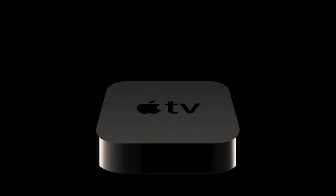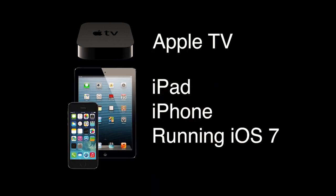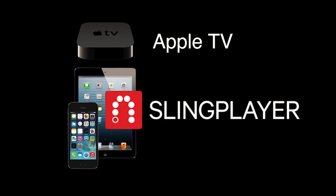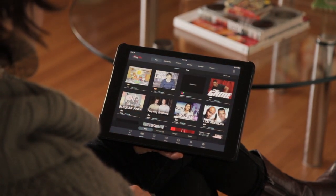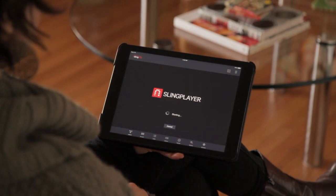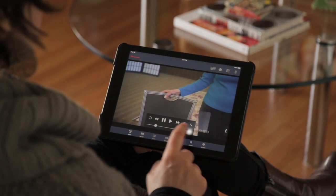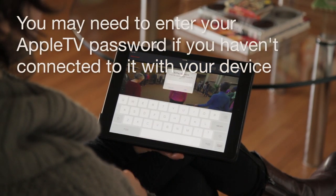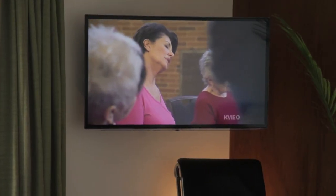In a very similar way, you can watch programs on a remote TV using AirPlay for Apple TV with an iPhone or an iPad running iOS 7 or later. Make sure that the iPhone or iPad has the latest version of Slingplayer and is on the same Wi-Fi network as the Apple TV. Launch Slingplayer on your iPhone or iPad and begin a streaming session like you would normally from your Slingbox 350 or Slingbox 500, then tap the screen to reveal the controls. Look for the AirPlay icon, tap it once, and then select your Apple TV from the list. And that's it — the TV will display crystal clear video from the Slingbox, and your iPhone or iPad serves as a remote control.